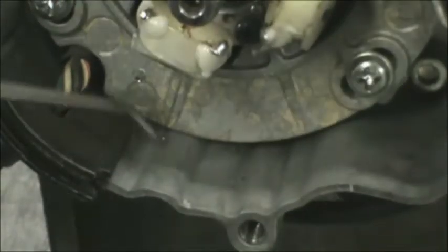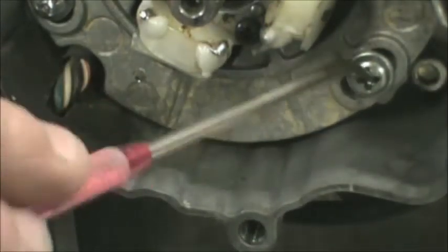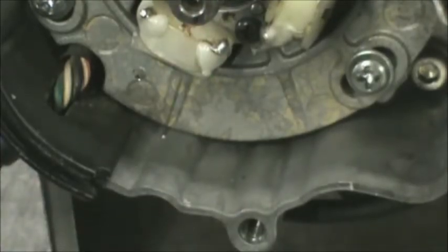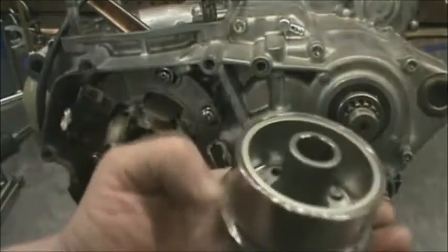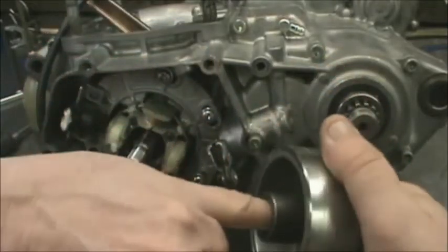There's my timing mark right there — I said a little bit of advance, and that's where I'm putting it. I'm going to use an impact driver and smack these heads a couple times, just really lightly to get them tightened up. I call them butter bolts, but I'm going to use that impact to get them down a little harder. To install the flywheel, just put your finger in here, feel around, make sure there's no burrs in there.